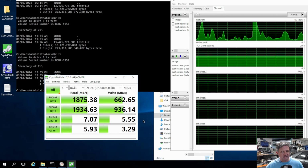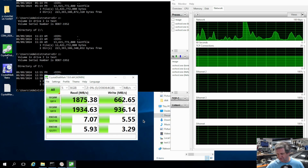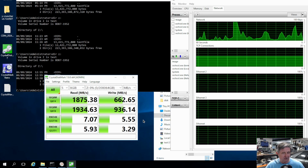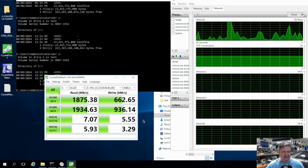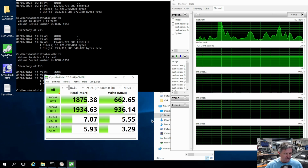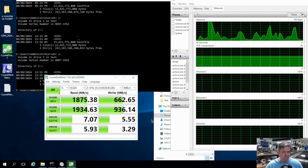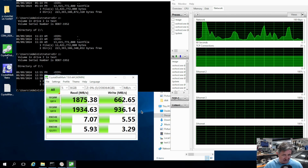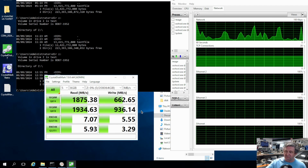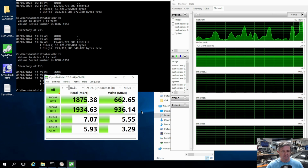So the write performance isn't hit quite as much, probably because there is overall very similar write performance in terms of being able to commit. But with only 2 vdevs, the number of parallel operations that are going to get blocked is a lot higher. These numbers do indicate what you'd expect to see, which is that with RAIDZ1, you're going to get a lot more disk space, but your random I/O performance is going to be worse. Your sequential is very similar, actually a little better in this case. So for an array where you're not running VMs, where you're just storing, reading and writing files for things like Plex, this would probably have higher performance than your mirrored array.